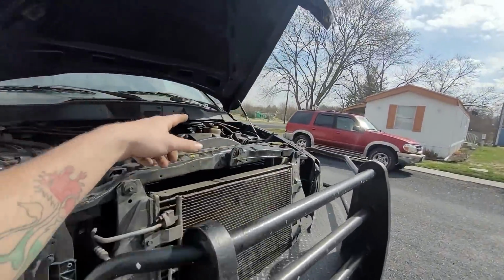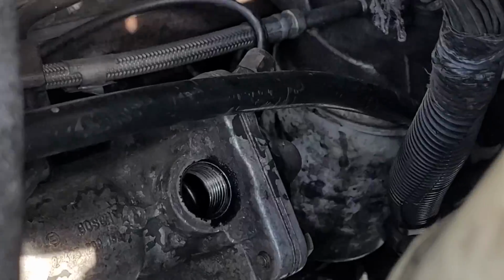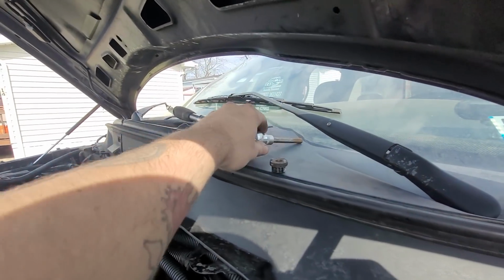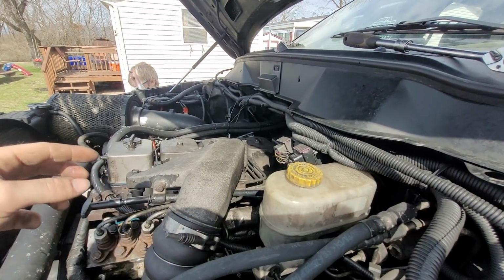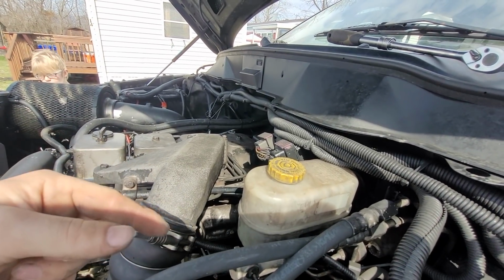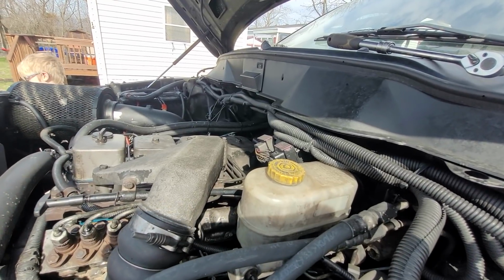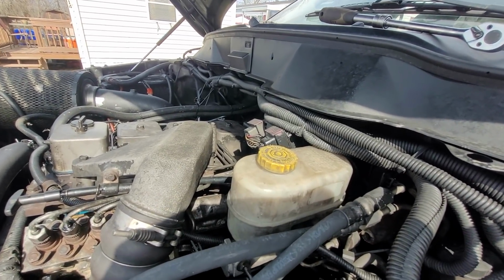I changed the pre-boost, which I'm gonna up a smidgen. Like we're doing the star wheel now, right there. Was an 8mm, so I had to get my tools for that, but I'm gonna take that and push it in. So pretty much there is a little bit of lag down below, so I'm gonna fix that right now. And I'm going to go ahead and take some fuel out in the mid and the top, because the rate that it comes on is too much. So I'm gonna take out about 10 clicks and see if that makes a difference.